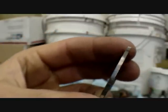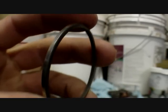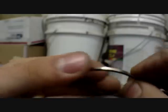Here I have one cylinder ring. I used my Dremel and a little polishing tip on the Dremel. Used very fine polishing compound. It's designed for last step application. But before you do this, you want to make sure you clean all the tarnish off. Use brake cleaner and rub it really well so that you're not polishing garbage. You want it to be actually polishing the metal.